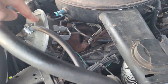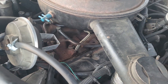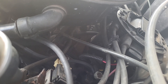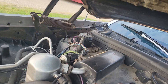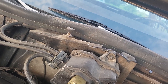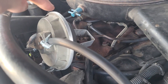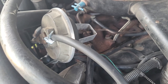I have to bypass that whole factory setup since it relies on the computer to adjust vacuum. So it goes from the firewall straight to the servo, which is attached directly to our throttle plate. Basically, the vacuum source originally for the automatic climate control signal vacuum goes through the firewall, behind the glove box, under the dash, into my valve, and then travels up through the brake release back through the firewall and directly into this servo. It is entirely analog — no computer involved.